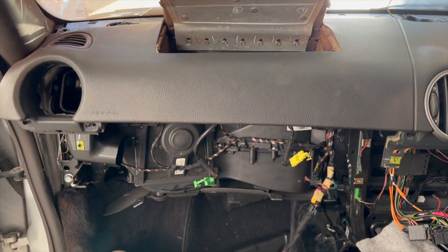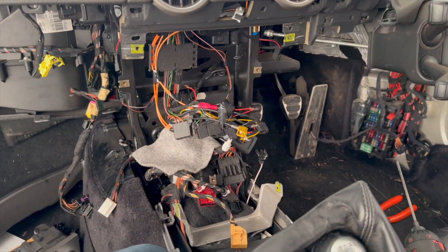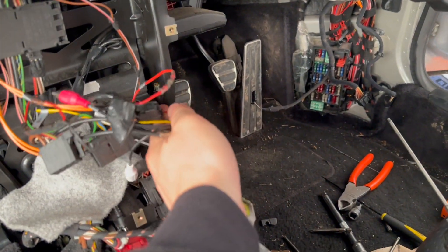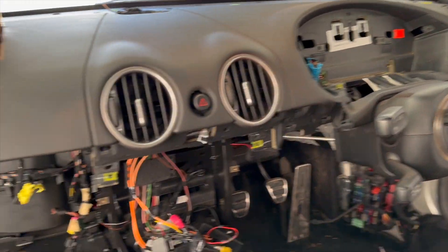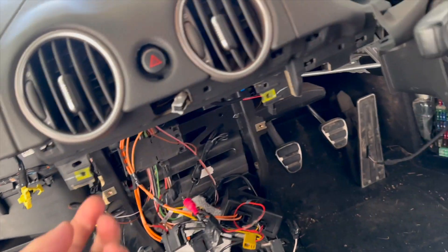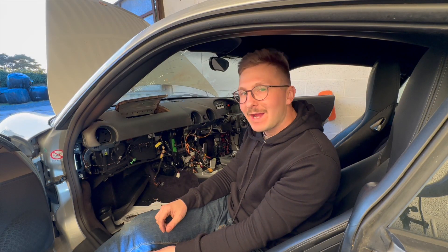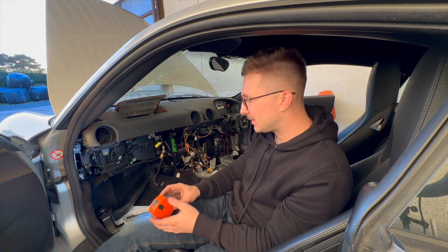Progress so far: airbag is out, and I've just got that center console piece out — it's quite intimidating, a lot of wires. Almost there — I've got to get these center ones out, but I need to depress the tangs underneath, just like on the other one. I needed this console out anyway. I believe all the screws are out for the dash now — fingers crossed — so I think it's time to give it a little wiggle and a bit of persuasion.